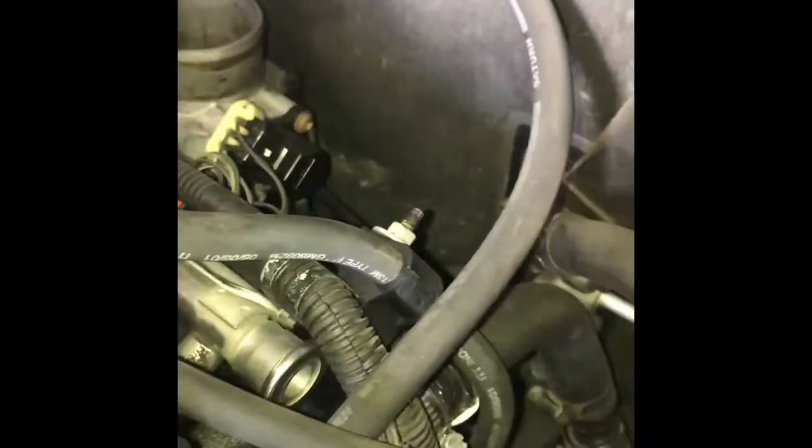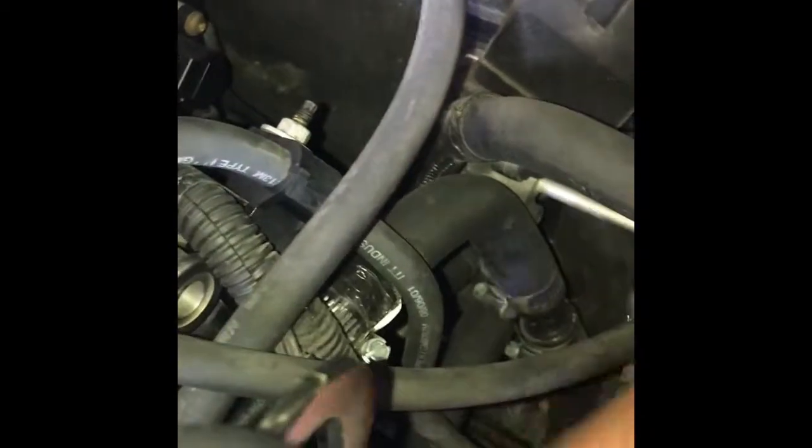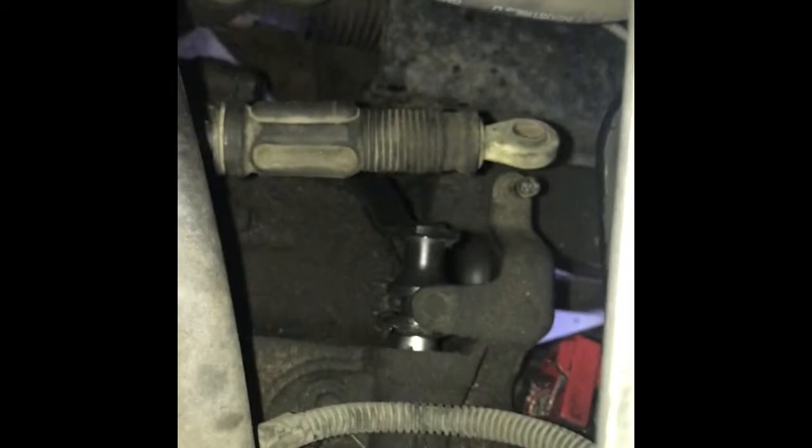I'm going to start underneath here. I've already got the top one off. They have these metal clips that hold it in there. They sit in there just like that. All you've got to do is work them, back them out that way. Then you'll disconnect it from the transmission shift arm there, and basically you just have these little clips. All you want to do is pick up on it and work it out carefully. Careful it doesn't shoot out and you lose it.